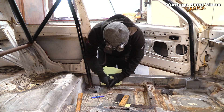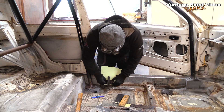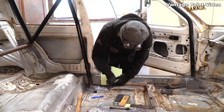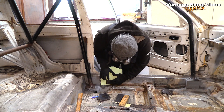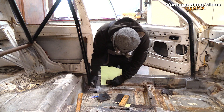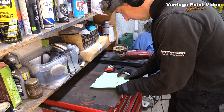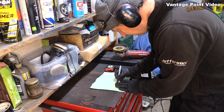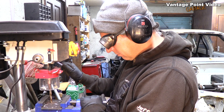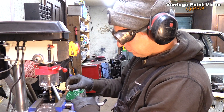Because this counter plate is larger than the area of the end plate, I'm using a little bit of paper to get a template for where the eye bolt will go, or if I'm using the original seat belts. Because there might be different scenarios - these cars actually rallied without competition seats, with just the Recaros in them back in the day. So I'm glad that these are going to be removable and that's why I've left the original floor mountings. I will be able to take the competition seats out if I want to and put ordinary Recaro road seats in, which might be nice to show the car as it was in the original era at shows rather than competitive events. So I transferred those measurements onto my plate and I'm using an 11mm drill bit for the threads of an eye bolt to go through.